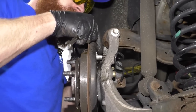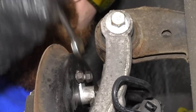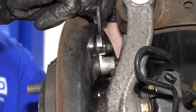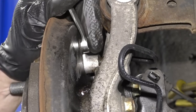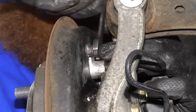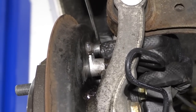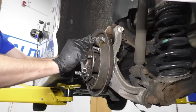Grab the other two 10 millimeter head bolts and start both of those in from the backside. None of this is fully tightened up yet — important to remember. Start the first bolt and give it a couple more threads; definitely not fully tight. The second one is a little harder to get to, but get that one started with a few good threads. Now go back to the 10 millimeter wrench and continue tightening the line until it's nice and snug — we don't need to reef down hard, just snug. Turning to the left because I'm working on the front side of something whose back is what I'm tightening. That bottomed out — give it a little bonk to make sure it's snug. Then tighten up those two mounting bolts the same way. We've successfully installed this portion of the wheel cylinder.